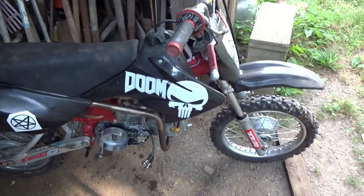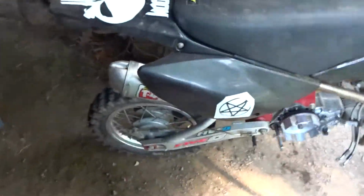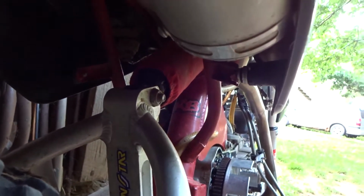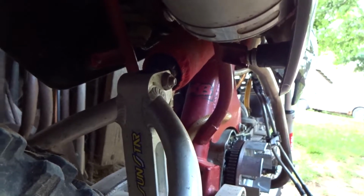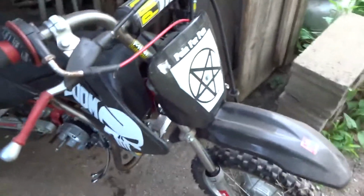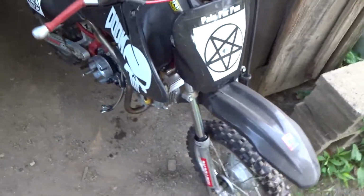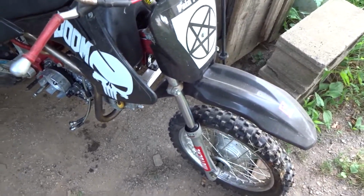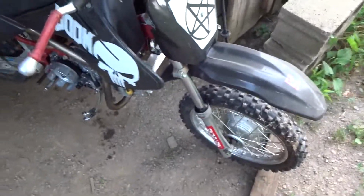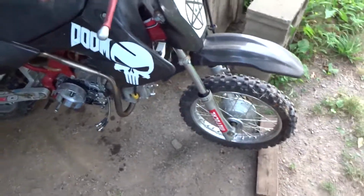The balance is just a tick off, being that I got this 5.0 Racing swing arm, which is +3 extension, and underneath that I got an iShock, and man, it has amazing dampening, but it's a lot stiffer than what my front forks are. And the stiffest fork springs I actually found were the BBR Racing Motorsports fork springs, and they just don't match the spring rate to the back of the bike that well.